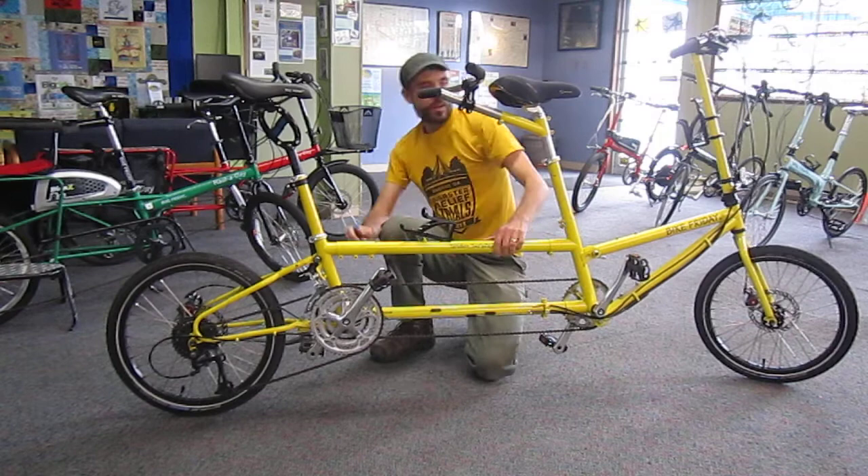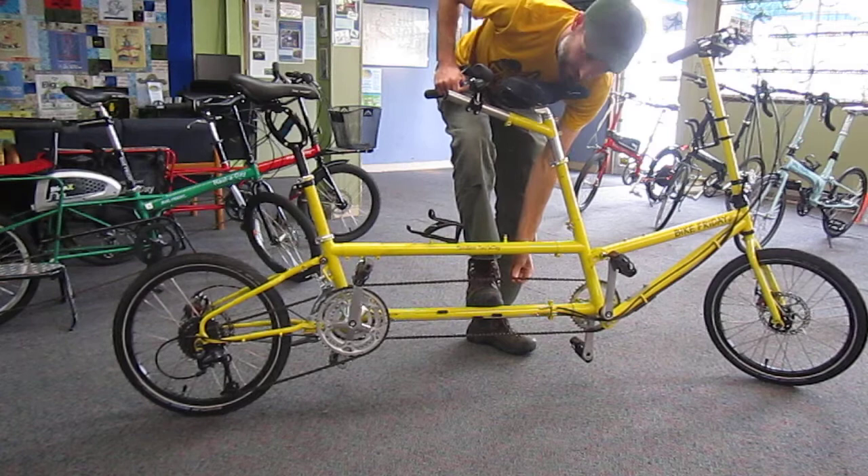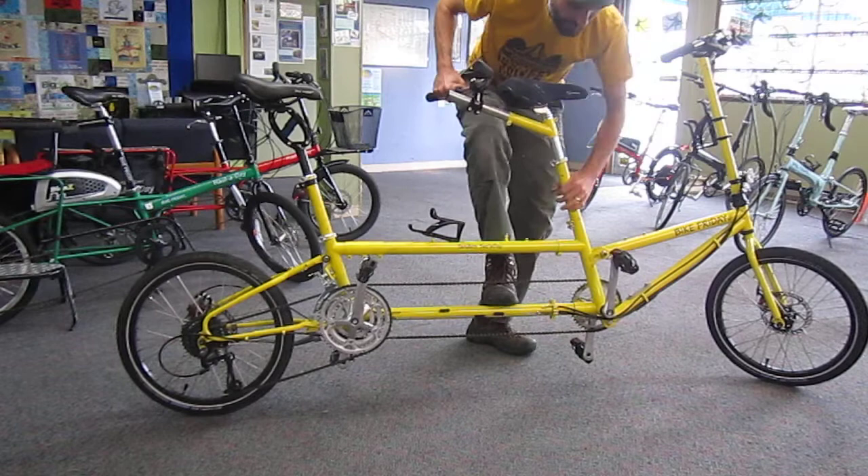With a loose bolt down here, I'm going to put weight on the bottom mid-tube again. This time I've got a nice tight chain — it's got maybe about an inch of deflection in the middle, so that feels nice and tight.